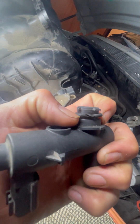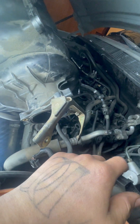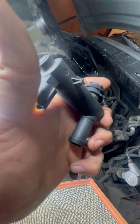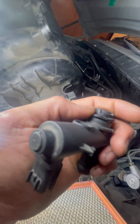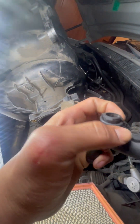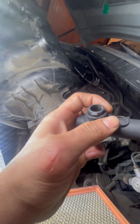It was super hard to find this leak, but I got it once I noticed the O-ring. I tested the valve with a power probe — it opens and closes like it should, and the purge valve as well. The hard part is just trying to find another O-ring of this size. I ordered a whole new purge valve even though this one works, just because the item is discontinued. That's pretty much what will cause a small EVAP leak on a Nissan Armada — let me know if you guys find an O-ring replacement somewhere.